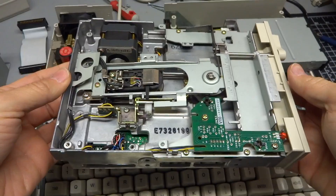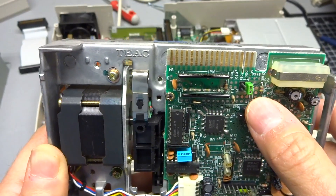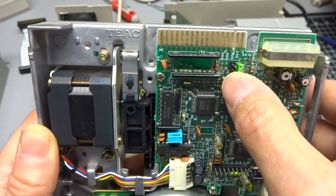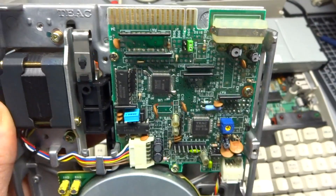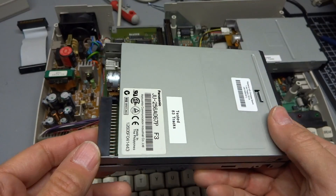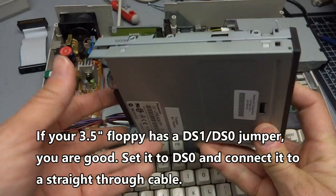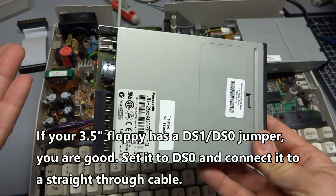Here's the reason why. Here's the original 5.25 inch floppy drive that was in the Tandy. In order to get this drive to work in the Tandy, this jumper here needs to be set to DS0, which stands for Drive Select Zero. A typical PC always requires the floppy drive to be configured for DS1 to work, whether you have it on the end or the middle of the floppy cable — it's always set to DS1. So that's where we run into our first problem. It seems that all the 3.5 inch floppy drives I have have no way to set them to DS0; they just don't have any jumpers at all, which means they're hard-coded at the DS1 configuration, which is what a standard PC needs.